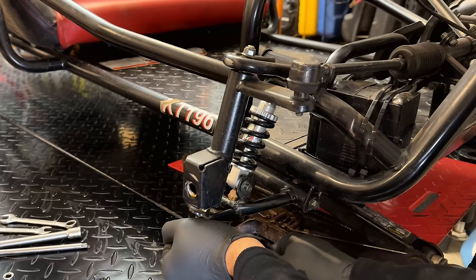We need a switch with three different positions, and I actually think I have one. I have a parts Generac over there that has electric start. It has a switch that I believe will just install right here without any modification, and that will provide on, off, and start capabilities. So let's pull that switch out and make sure it's going to fit and do what we need. And we'll get that installed. We'll finish wiring the front.